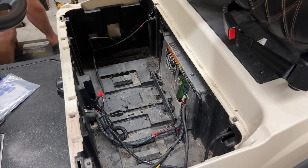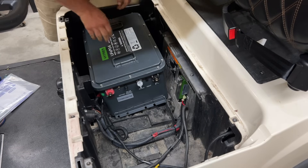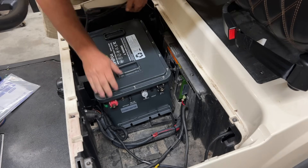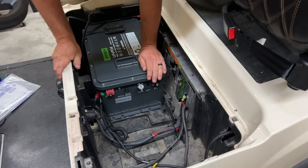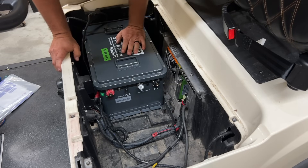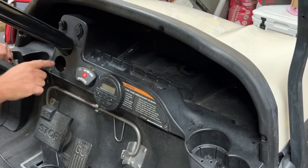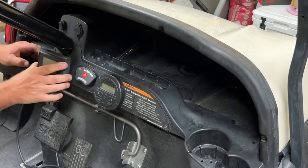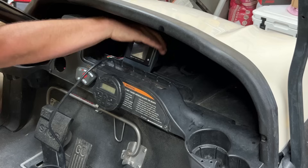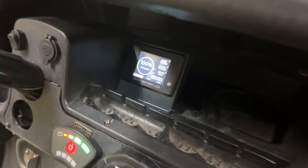Let's get this battery installed. It fits well inside the cart with plenty of room for storage or a small cooler. The battery gauge is sitting in a metal tray through a bracket — we could cut a square and mount the gauge there, or leave it in the included bracket and mount it up in there since the bracket has three holes. I went ahead and mounted the gauge that came with the kit.